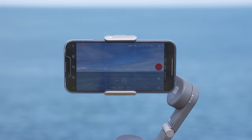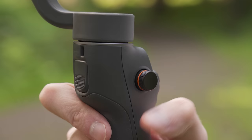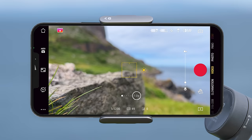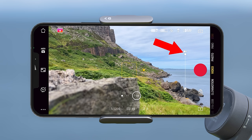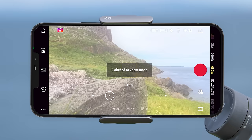You can also zoom in or out by using two fingers and pinching in or out on the screen. Pressing the side wheel on the gimbal changes to manual focus mode — turning the side wheel changes the focus, and you will see a new icon on the right side showing your focus level. The icon at the bottom represents macro or close focus, and the icon at the top represents infinity focus. To get back to auto focus and zoom mode, simply press the side wheel again.